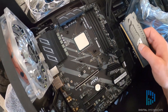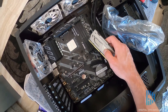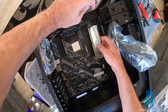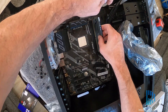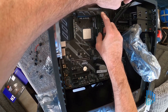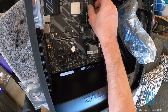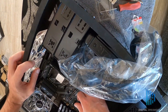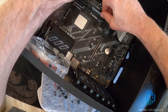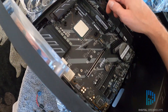But I was pretty sure when I ordered the RAM that I'd be able to get a stable clock speed, just maybe a little bit slower — which ended up being the case. I settled at 3466 MHz as a stable clock speed for running four sticks of memory. It's a dual channel board, so I grabbed two dual channel sets for a total of 32GB. It's all installed, looks great, and it's running fine at 3466 MHz.